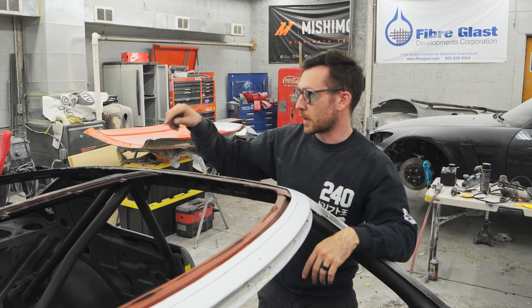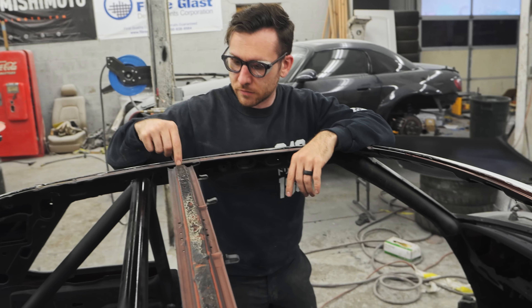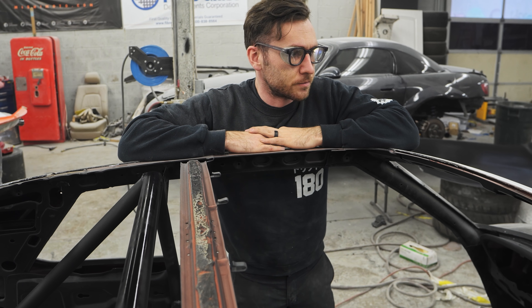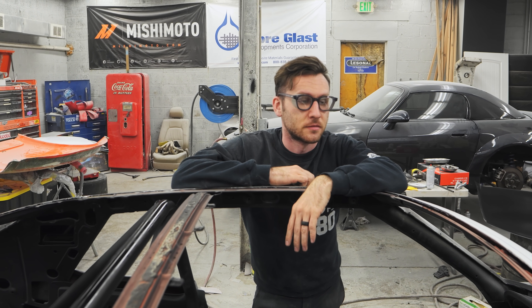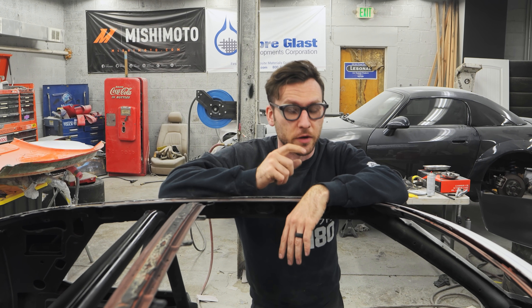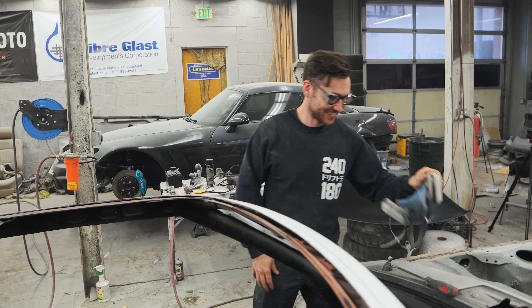I'm going to do the same thing all the way around. That strip doesn't look like it was ever actually stuck - it's like a soundproof foam rubbery strip, not really a glue. At least for the first test fit we'll leave it. As for the bare metal from grinding off the paint, in this case we're going to make sure we cover all of it in the epoxy we're bonding the roof with. But if you leave any bare metal exposed, you'd want to hit it with self-etching primer - that's stuff we use all the time.